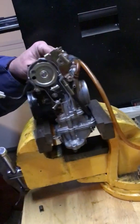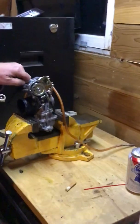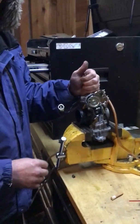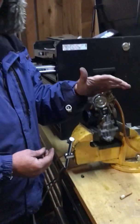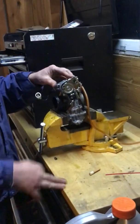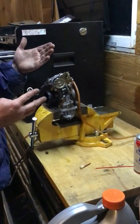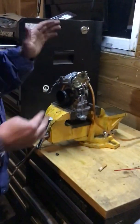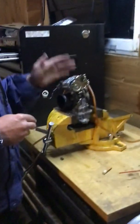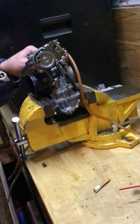And I don't know if the other guys on YouTube have addressed it. Not really, from what I can tell. A lot of them are like, oh yeah, more fuel is more power. That's not always true. So if you understand how fuel metering works, and especially what the accelerator pump's designed for in the first place, it's not like a power valve, you know what I mean? I know it gets misnamed that way a lot, but it's wrong. All it's there for is to keep the motor from stumbling when you open the throttle slide all the way, so that sudden change in atmospheric pressure doesn't starve the motor of fuel. All right, that's it, because the jets can't do it. But after that, once it's full throttle and the motor's spun up, everything needs to be running off the jets. If that thing is still shooting fuel in there, you just get a fouled plug, or, if it's hot, it's going to make it run even worse.